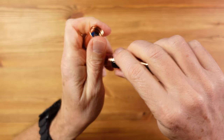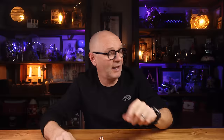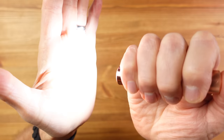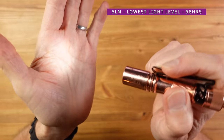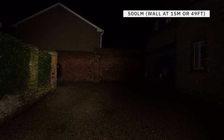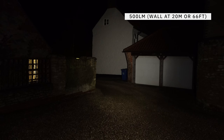The battery is a 920 mAh MN14500 with a built-in USB charging socket, the same size as a standard AA, which can be used as backup power in an emergency. There are only three light levels: 5, 100, and 500 lumens. The 5-lumen level has a 58-hour duration, 100 lumens runs for 5.5 hours, and then there's the short-runtime 500-lumen level. Usability-wise, it's the simplest in the lineup: press the tail switch to come on at low, off and on for medium, off and on for high.